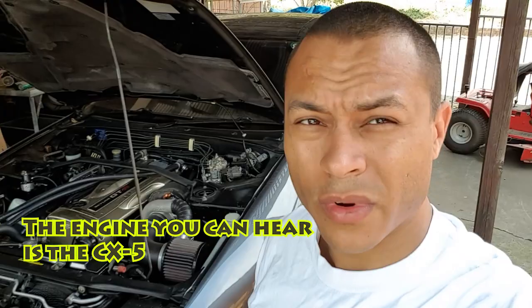So at this stage, what I'm gonna have to do is probably drop the gearbox out completely. Engine's perfect, but the freaking gearbox just sounds terrible. So the only option it seems that I've got is replace the box with another stock box, or take mine out and clean out all the crap that's in there. I kind of don't want to get another stock box, even though it probably would be the easier option, because it's just going to lead me to being in the exact same place after spending $1,000 to $1,500 on a factory gearbox that's secondhand. For that kind of money, I'd rather just save up a little bit more and go the gear set.